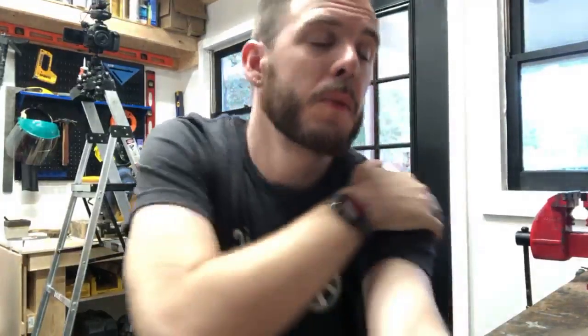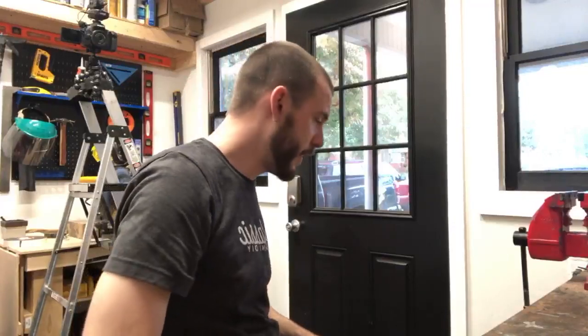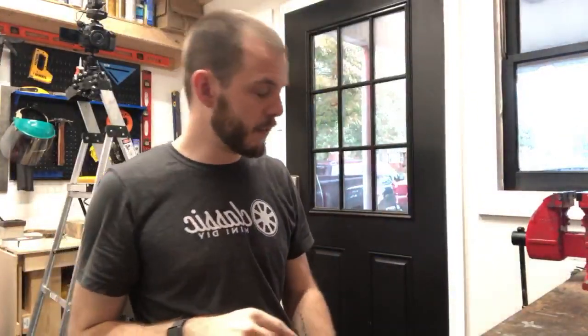Lone Star Mini says, with the electric distributor, do you have to worry about a splash guard? Otherwise, what is the best splash guard you have found? With the electric ones, I don't really worry about it. The points were really finicky with water, but even if you switch to just the electromagnetic one that I showed you guys earlier, you don't need a splash guard anymore. It kind of defeats the need for one of those splash guards.